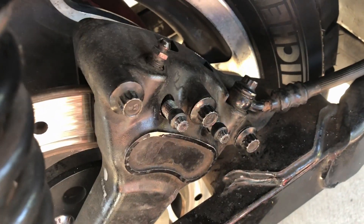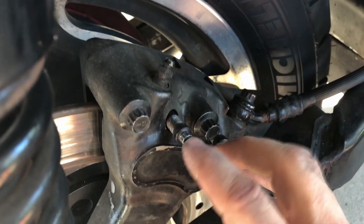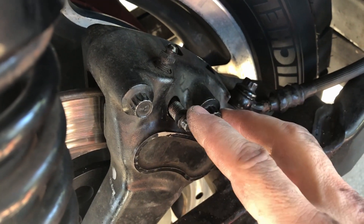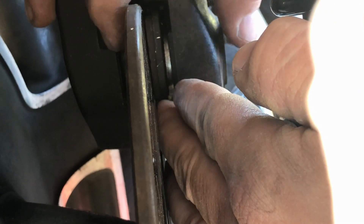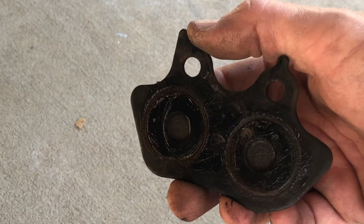What I'm going to do is take a putty knife and work on the first — the inside brake pad, the one towards the tire. I'm going to try to get my putty knife in between the rotor and the brake pad and try to push the pistons back into the brake caliper. We're not going to pull the pins out all the way — just pull them out halfway to release the inside brake pad. There's an anti-vibration spring up in here and it'll be more difficult if you pull them out and that spring comes free. Remember the orientation of this pad — that hook up here goes forward.